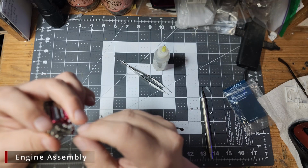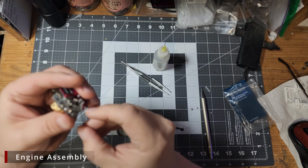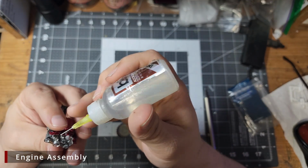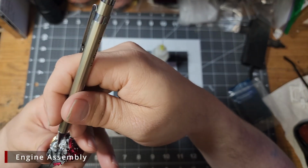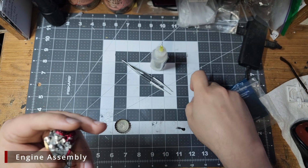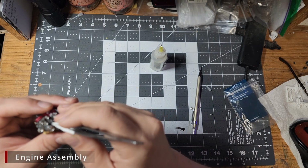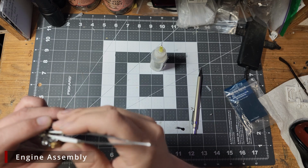You can see what I mean here about the pulley footage being really bad. To be honest with you, I'm not even entirely certain which pulley I'm on at this point. I think I may be setting the supercharger pulley. Yeah, that must have been the supercharger pulley. At this point, we're going to wrap the belt to the inside of this idle tension pulley, and then we'll finish off back at the bottom of the crankshaft pulley.